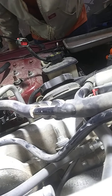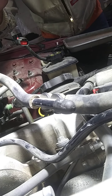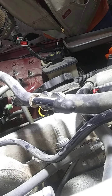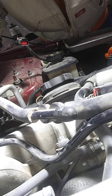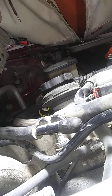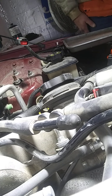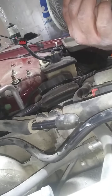Oh, I might have smoke coming out somewhere else, too. Let me check again. Uh-oh, looks like I got an intake manifold leak, too. Gasket leak. Looks like I got an intake manifold gasket leak, right down in yonder hole where that bolts down. The bottom half. This is the upper plenum and then there's a lower plenum.